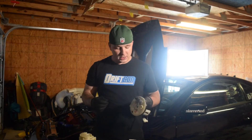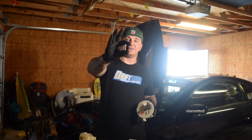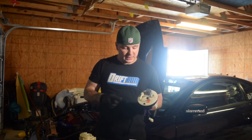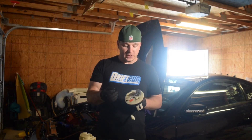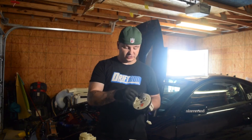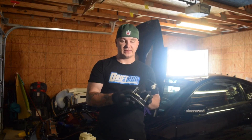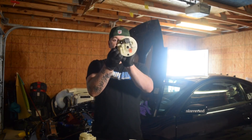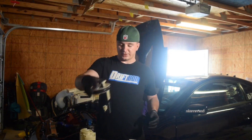I had to modify the return a little bit. The return on here is kind of small compared to the 3/8 high-pressure side, and the low-pressure return side would definitely be restricted just clamping it down. I'm using a dash 6 union with a straight cut on one side for placement. I ordered a much longer one made for a bulkhead or fuel tank so I can mount it with little bolts and clamp it between the two. The opening is a much bigger opening so you can get a good amount of fuel return. It's going to look a lot better once it's in the car.